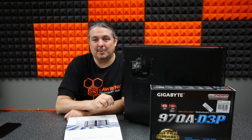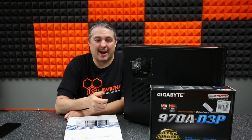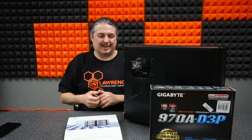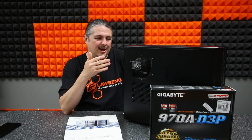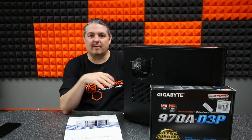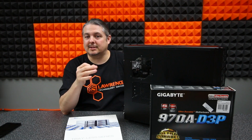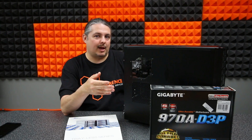And I've even talked to engineers that worked at Ubuntu, and they like it. Some of their back-end stuff does run on it because you can literally just shut it off. They don't have to worry about it write committing. They can actually pull them out and just say, boom. And it's amazing. It recovers perfectly fine. We've had power failures at other places in our own ZFS, and I've never once had it have a problem. And we've replaced drives and rebuilt the RAID arrays in them. I can't say enough good things about it. And that's really what matters, is having really good reliability on this.